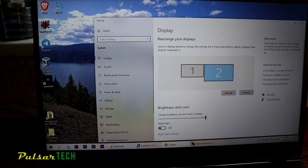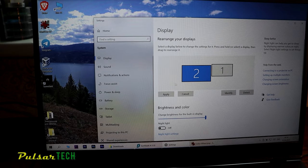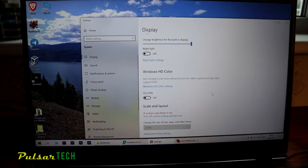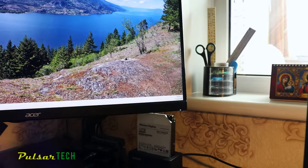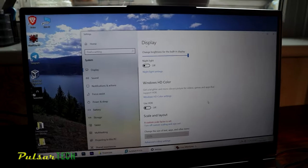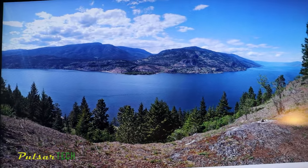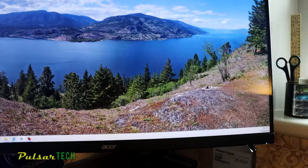So there you have it guys. Let me also show you how to quickly swap the monitors from left to right — just click apply. So the only thing that was a problem with this monitor is this 'Use HDR' button. Whenever you enable HDR on your monitor it automatically switches Windows to HDR mode, because Windows detects that you have an HDR monitor. But when you switch back to normal mode, eco mode, or standard mode, Windows still thinks you're using the HDR monitor and sends different colors. The monitor isn't in HDR mode so it just shows really weird colors.